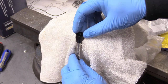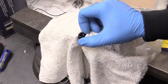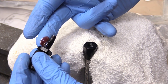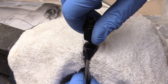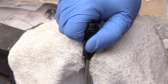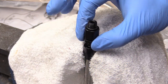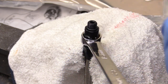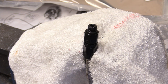Put the line upside down in the vise with a nice terry towel and snug it up — not crazy tight. Grab some assembly lube and put it on the threads of the fitting. Install the other fitting on the line and wind it in by hand. As it gets very firm, it is swaging that material, making it really awesome and leak-free. Grab a 16mm wrench and continue tightening — just snug it up, don't go crazy tight. That's ready for installation.